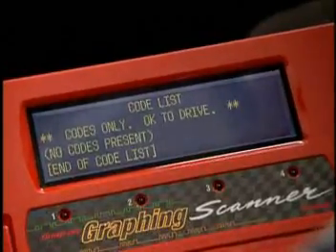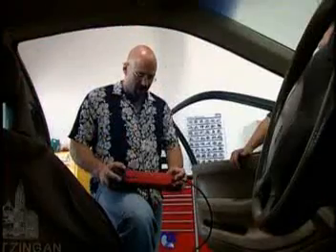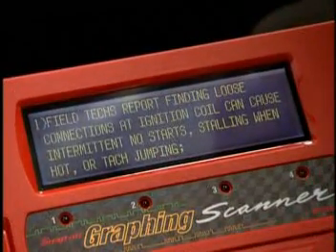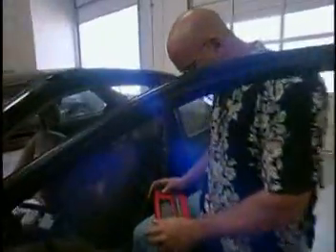You're in the right spot. It's a three-pin Honda ignition connector. No codes. How about symptoms? Symptom tips — no starts, stalling hot, TAC jumps. Field tech reports finding loose connections at ignition coil can cause intermittent no-starts and stalling when hot.